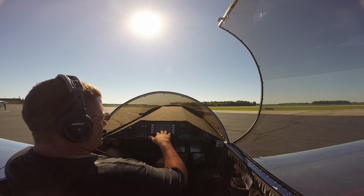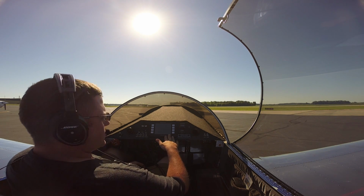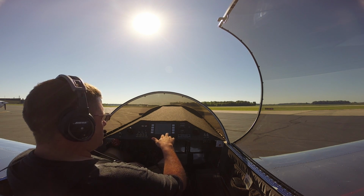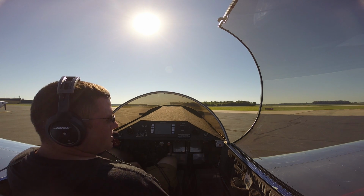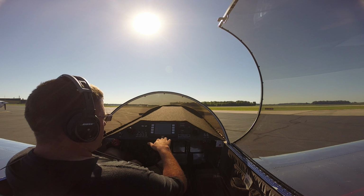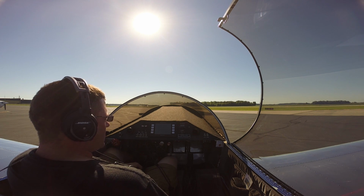So I know it's really tough to see the screen right now, given the sun and also just where you're located at. So right now, the local altimeter is set in. Altimeter is 1,080 feet. Field elevation here is actually about 1,030. I taxied over the fuel pump, so my engine's already a little bit warm. Cylinders are all 150, 170 at this point. Oil's almost up to 100 already.